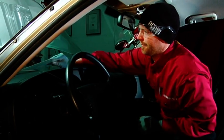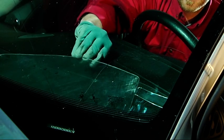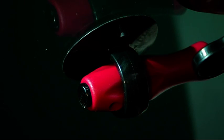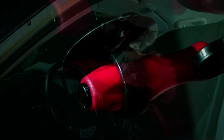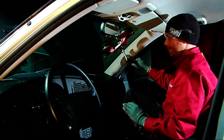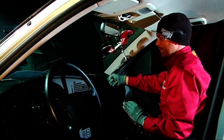Make sure to protect the instrument panel, A-pillars and roof by moving along the plastic covers during the process. Use the parabola chisel to keep the wire against the glass and away from the interiors. Operate the ratchet and start cutting through the adhesive bead under the glass. If you don't get enough room to operate the ratchet, you can use the extender.